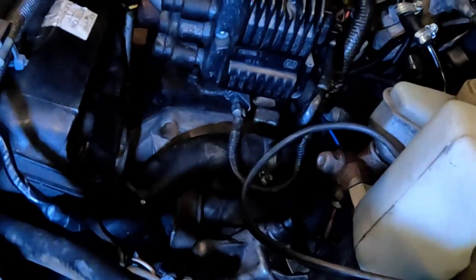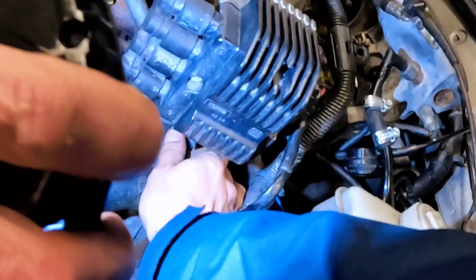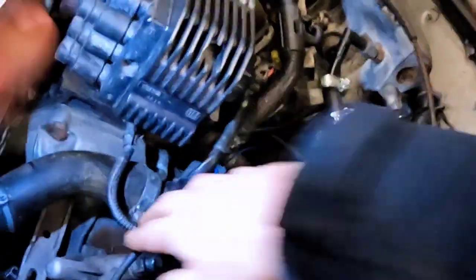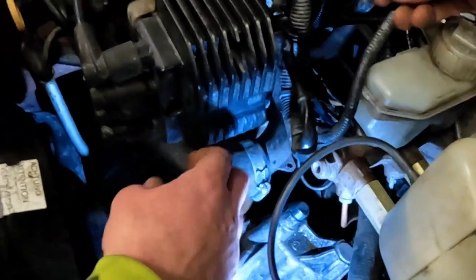As you can see, the coolant temp sensor is hiding underneath the coil pack, and it's got a super stiff clip on it. We'll look into that. Cool, well that looks good. We've no green or anything, and the wires are nice and fresh, as they should be, because this engine's only done 32,000 miles. That'll be a standard issue 19, and it's a square-ended one.